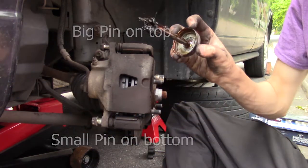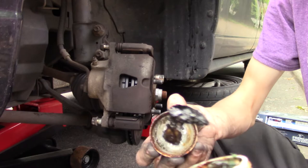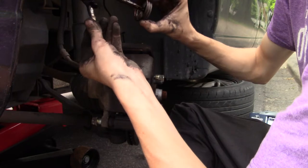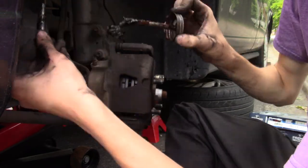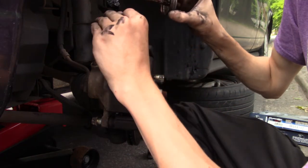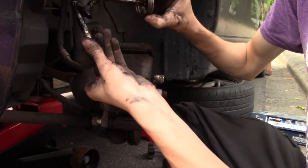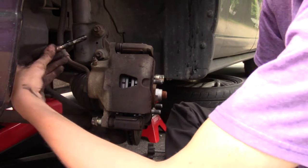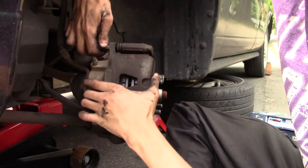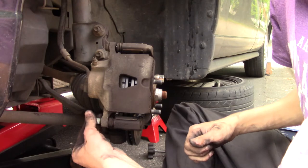So now we get our extra brake part lubricant, and we're gonna need a brush because I'm running low on this stuff. Get a good amount and then just go all over this thing. Do not even think about being gentle. You want this stuff to be extra lubricated. Don't get it on the threads, just on the non-threaded part. Then you stick it in there. That'll figure out what's too much, not you. And then just screw it in. Bam. Now do the same thing with this one.